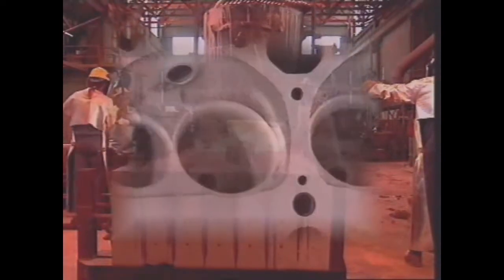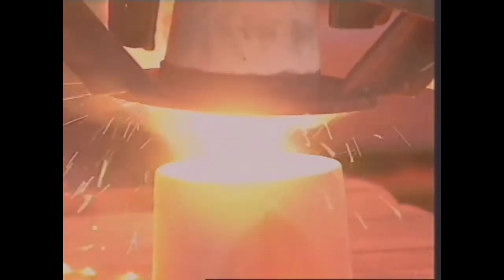Manufacturing the head is similar to manufacturing the block. A casting mould is made. Sand cores are put in to form any hollow areas. Depending on the engine, these can be for coolant and lubricant passages and inlet and exhaust ports. Air-cooled engines have cooling fins cast into the cylinder head. The underside of the head is shaped to form the combustion chamber. Molten metal is poured in and allowed to cool. The cores are broken out and removed, and the cylinder head cleaned of any sand.